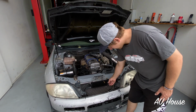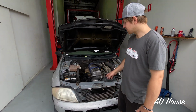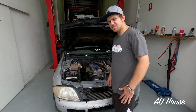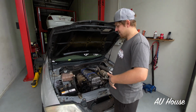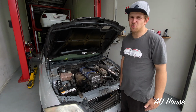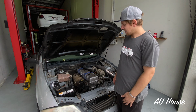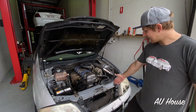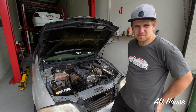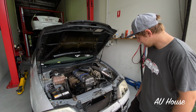Power steering cooler at the front here, at Archerfield, run after run, something you need to have. So that's just basic maintenance under here: water pump, harmonic balancer, recent alternator, those kind of things. Spark plugs, fuel filters, just to keep you going. So that's all under here. It had aircon, it stopped working. Too much limiter with the aircon on, and I think the compressor crapped itself. So that's it under here.